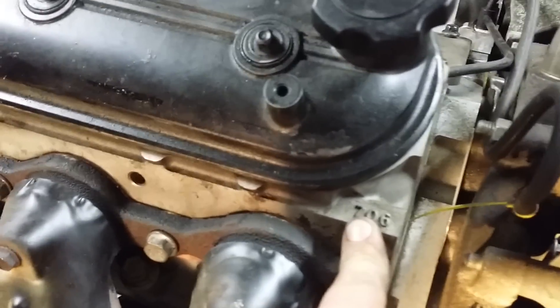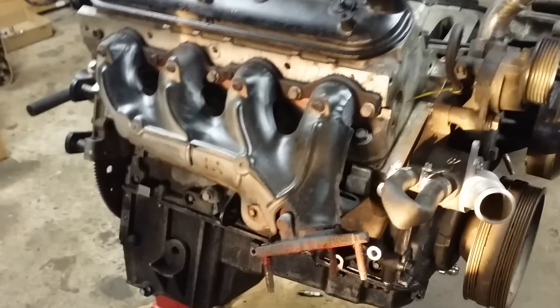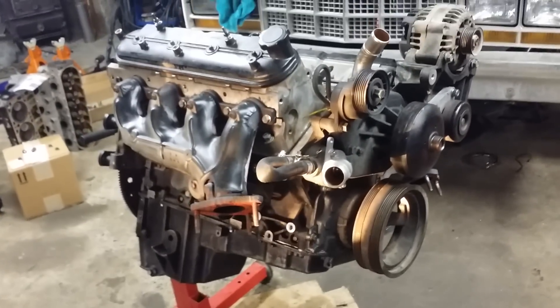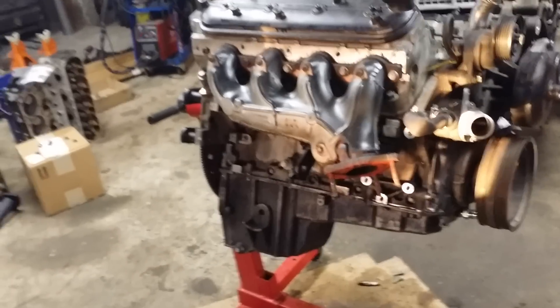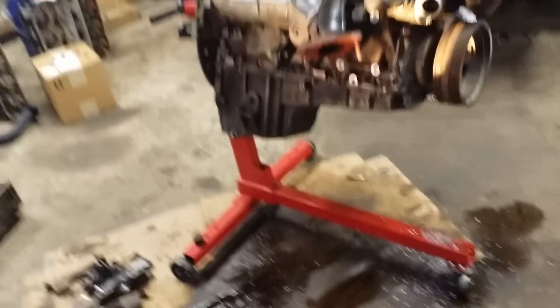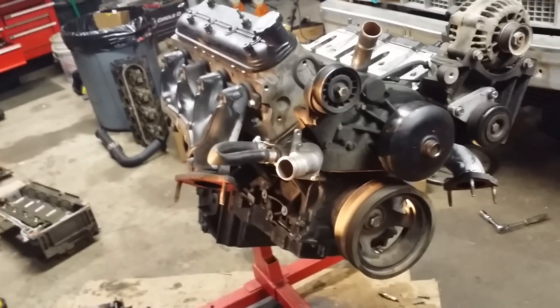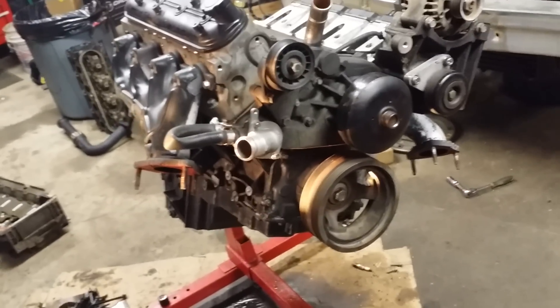This is another set of 862s — basically a 706 is made by an outside vendor, it's the same thing as an 862. I always wanted to try 317s; people used to put 317s on their dished-piston 5.3 and knock the compression ratio down into the low range so it'd be okay on 20-30 pounds of boost. But the flat-top motor with the short cylinder head — the 862 — is nice, it's like mid-tens compression. A flat-top piston and 862 head gives you a very snappy feel off throttle, then boost comes in and it's even nicer. You're not really giving up anything by adding compression — it's not like old-school thinking where you had to run 7.5:1 to run a blower because tuning technology simply wasn't there.